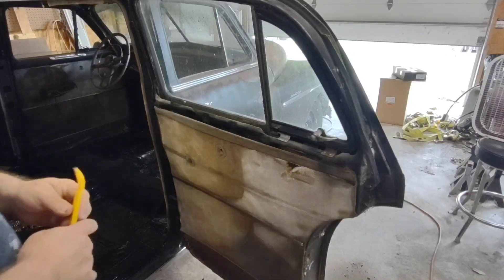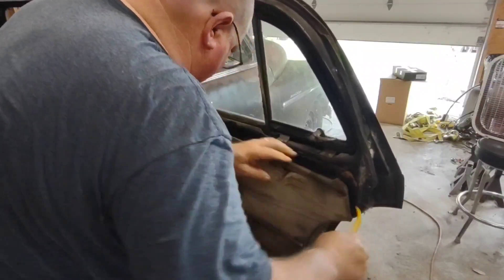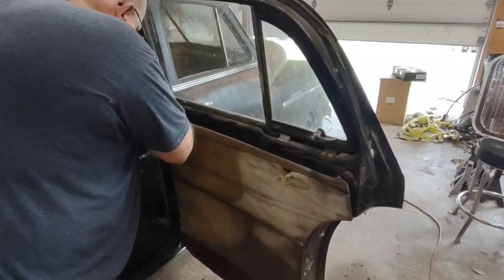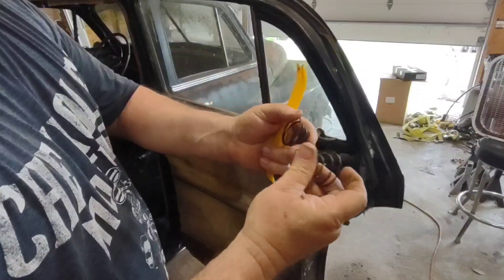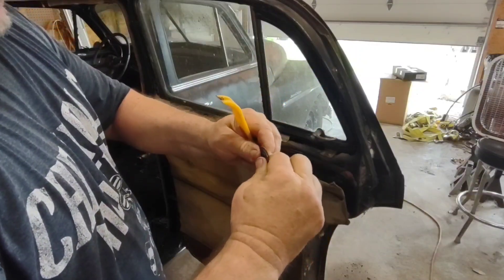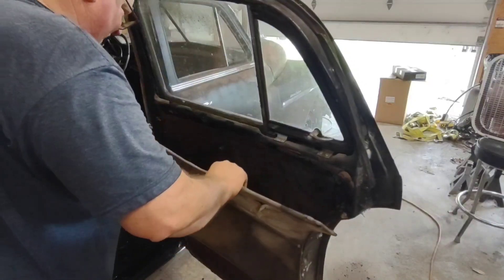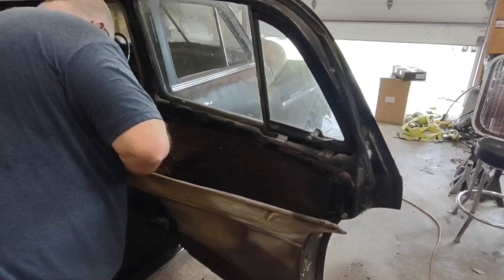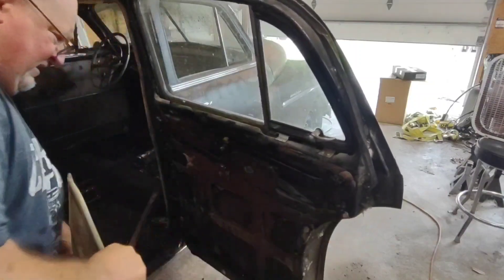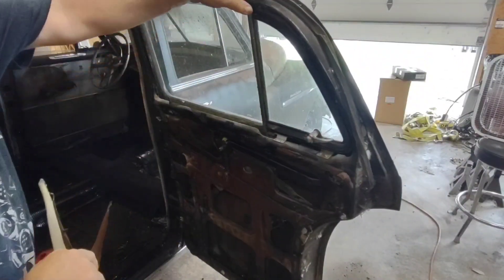Now as far as the door panel itself, it has little pins that push through, but this panel is going to tear so it doesn't really matter. Where the door handle and window crank are, you've got little springs that push out against the panel — that's why you're able to shove back and get those pins out. There we go, that came right off. This is the paper — kind of oil-soaked interior paper piece — get it out of the way.